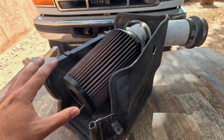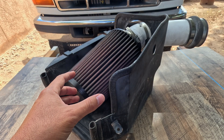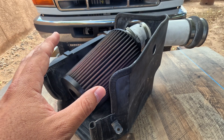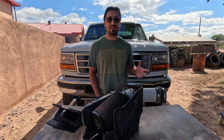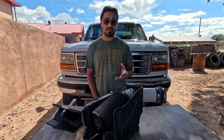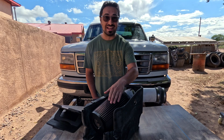This is your pretty typical cold air intake design — it appears to be an older K&N kit with a K&N air filter, cleaned and re-oiled before the test for the most accurate results. I've had concerns with this kit and similar designs. Cold air intakes like this take in an absolute ton of air, but the issue is that the air is primarily coming from inside the engine compartment, where it's being heated up by the engine, turbo, headers, radiator, etc., before it even enters the intake.